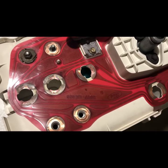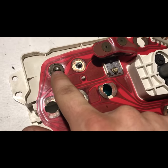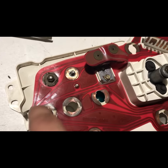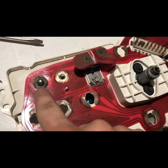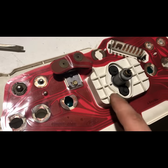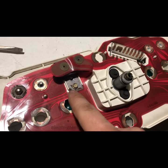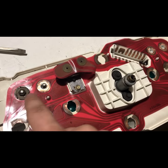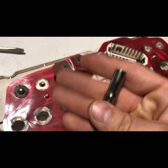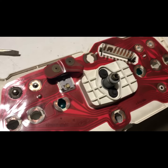Go figure, I hit a snag with one of the studs on one of the Econoline gauges — it's just spinning. So I'm going to see if I can hold the threads with a pair of vice grips. But in order to do that, I'm going to have to take the speedometer out. All of these were 5/16ths, and all of these speedometer bolts are going to be a quarter-inch deep well.